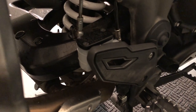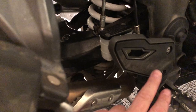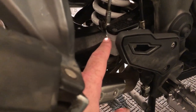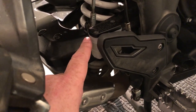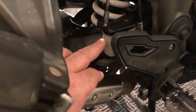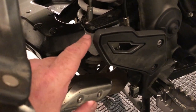Just about to change the rear brake pads on a Triumph Tiger 1200. Here's the rear brake reservoir on the right-hand side with its protective heel cover. I can see it's right up near the top mark — it's been filled right up on the last change. If I put new pads in here, I'm going to have far too much brake fluid. I may not even be able to get the pistons back because it'll just airlock. So I need to get a syringe and take a little bit of this out.